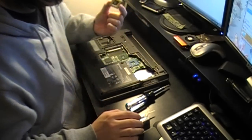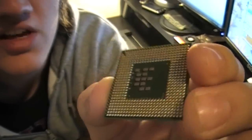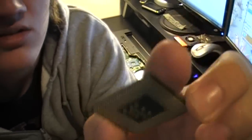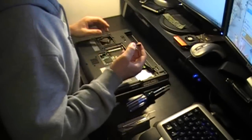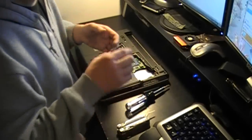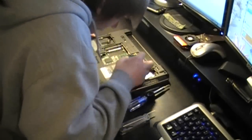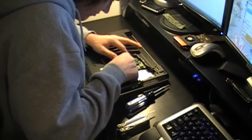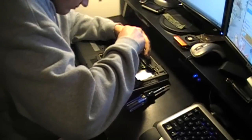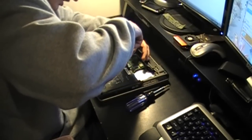Be careful not to touch the bottom, just like a desktop CPU. See that? Pins. You can always tell it's a mobile CPU just because it has that one black little heatsink on top. Desktop computers have a metal heatsink on top. Watch for the triangle — align it over the triangle, and we're golden. Carefully tighten it back. We're good.